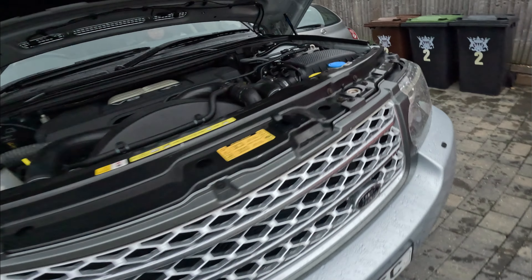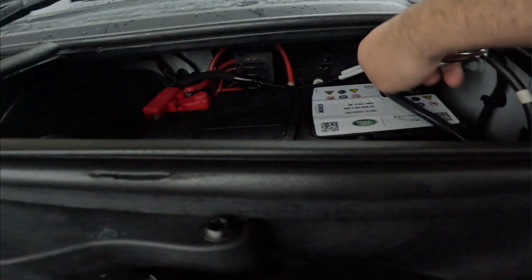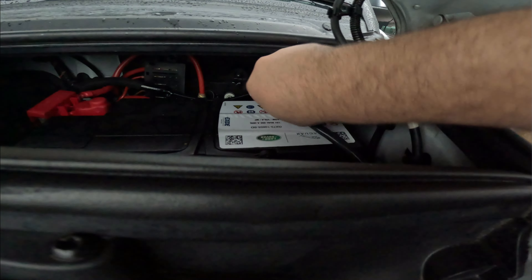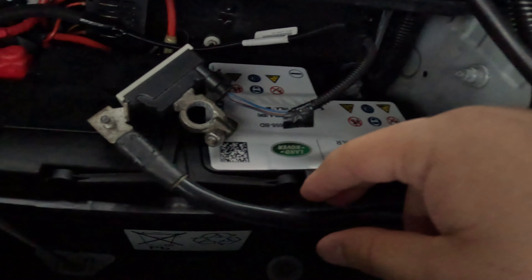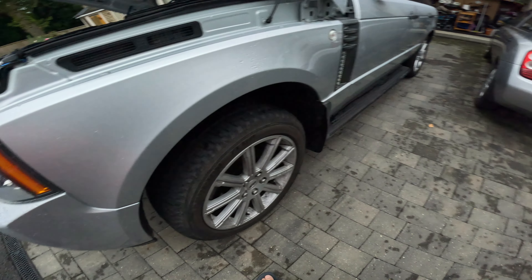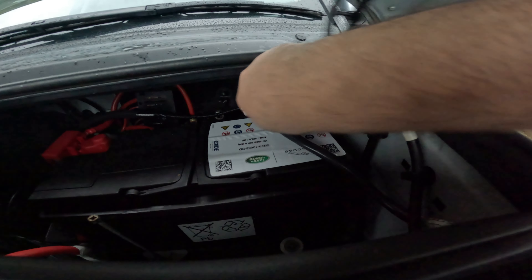We have to go back and reset the system. The problem is not in the sensor or the actual wheel — it's just miscommunication with the ECU. We're going to disconnect the battery after putting it in standard mode. This is due to me messing around with the car a lot and our driveway. We disconnect the battery, wait 10 minutes, then connect it back. Suspension miscommunication after working on suspension is completely normal.